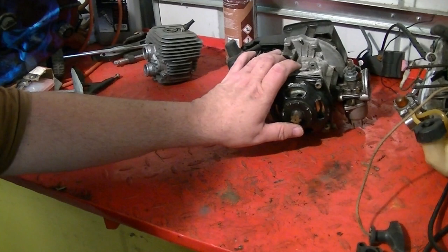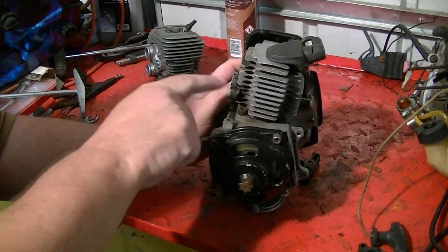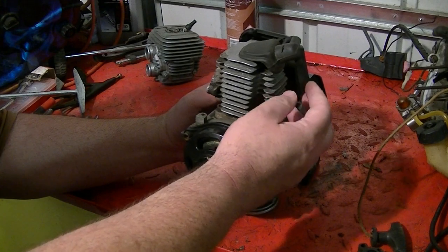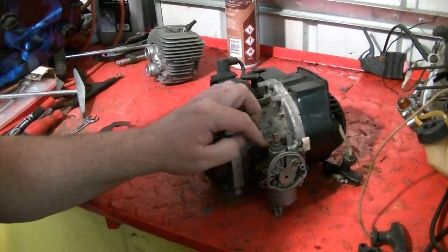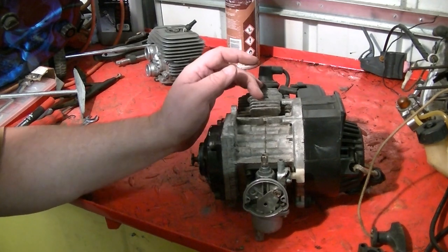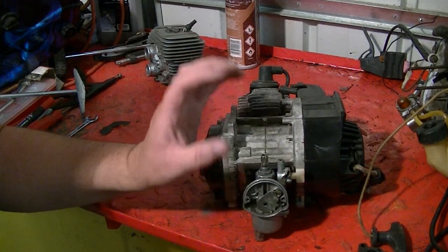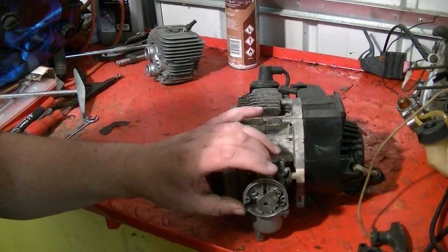So what's different about our mini motor engine? Well, if you stand it up on end, you'll notice it's got the exhaust next to the piston — the piston acts like a valve as it closes the exhaust port. But there's no inlet port on the side like strimmers have. The carb goes straight onto the crank housing. What happens is the piston goes back up the cylinder, causes a vacuum which drops the pressure in the crank housing compared to the carb side. That vacuum sucks the petrol and oil through — this is a two-stroke mix.